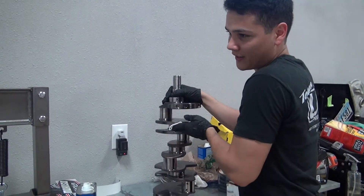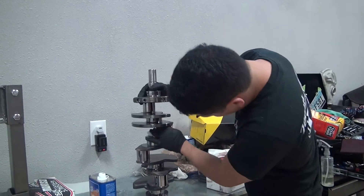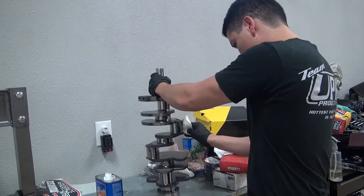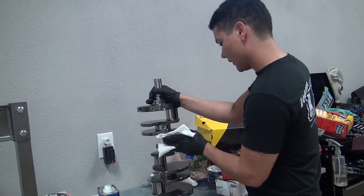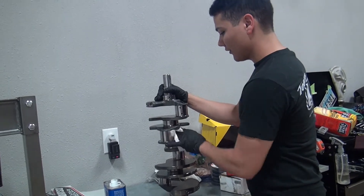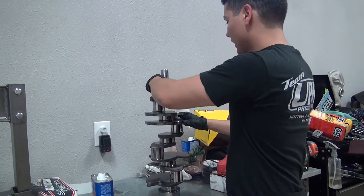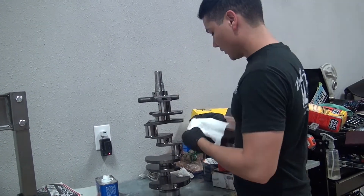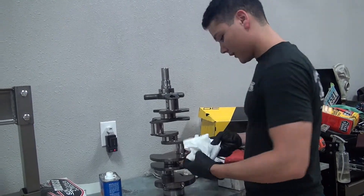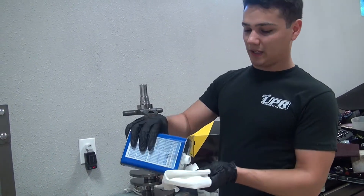Next, I'm just cleaning the crank, and I'm using lacquer thinner to clean all the main journals and the rod journals, so I'm just putting paper towel on them and going across. I blew out all the oil galleries with the air compressor, and I just want to get this as clean as possible. I'm using a white rag so I can see how clean it is — see, there's nothing on here. They machine all the stuff and clean it before they machine it, but you've got to clean it after, because all the debris and metal bits are left. This crank they didn't turn over, but they did polish it, so I want to make sure any polish or metal bits are cleaned off. Next we'll be dropping in the bearings into the mains and then dropping the crankshaft in.